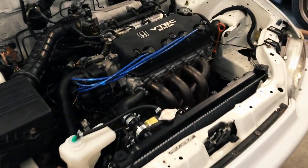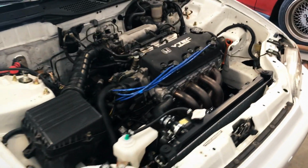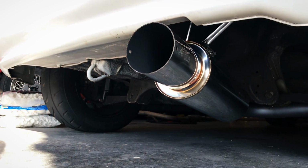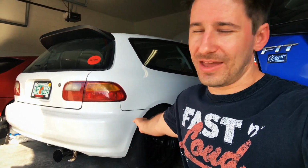And now with this exhaust manifold, the cast iron piece right there, and now this new piece, this right here is saving 6 pounds. So very nearly 100 pounds has come off the front of this car. And so again, back here, if I'm adding 11 pounds, to me, that's not a big deal, especially since it's hanging off the back. I think it's okay, man. I just think it's cool how everything has come together and how weight has been moved around in this car, and generally how much weight has come off of the car.